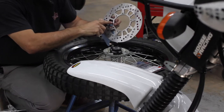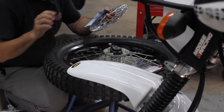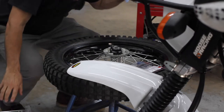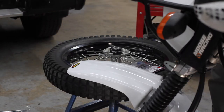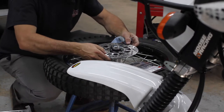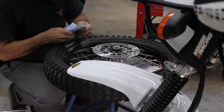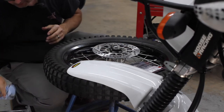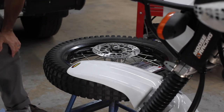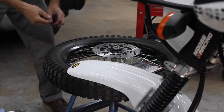You will see an F on the rotor. That's facing out. That's how it came off. That's how you want to put it back on. That front original rotor had never been replaced. And what mileage am I at? I think I'm at 12,000. Yeah, 12,126 miles. And I'm a little overdue because I checked it during the winter there. And yeah, I should have changed it maybe 200-300 miles ago, maybe 400 miles ago. But yeah, I'm sure you guys might get more mileage out of it.